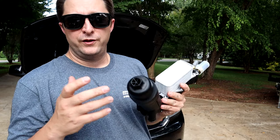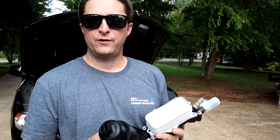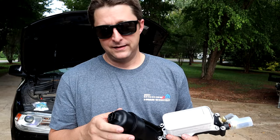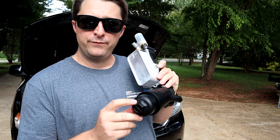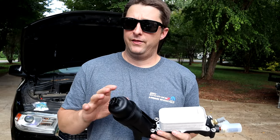So you don't have to go all Hulk Hogan on this thing and crunch it down until you start hearing things crunch and crack. Not good. 25 Newton meters is what they recommend, and that's it.